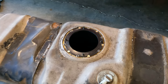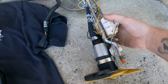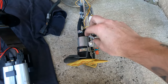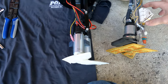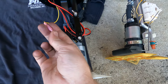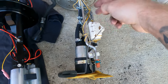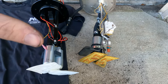That went pretty well — the gasket stayed on the tank. Here's the stock hat versus the billet fuel hat we're installing. Basically you have to take the level sensor off the stock hat and put it onto the billet hat. That involves two bolts — you cut the wire and splice it into the wire on the billet hat. Undo the two bolts, cut the yellow wire, put it on, bolt it down, and crimp it.